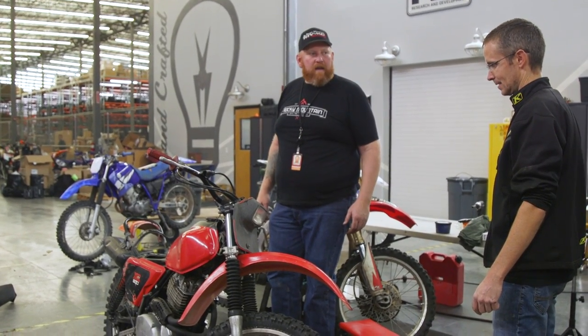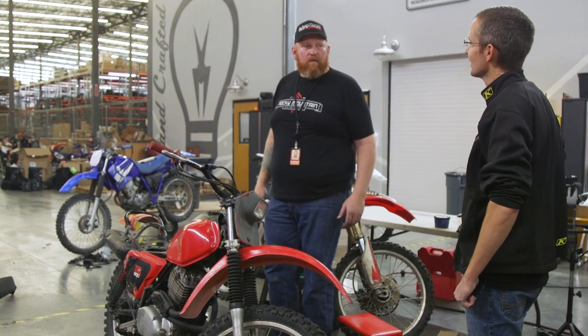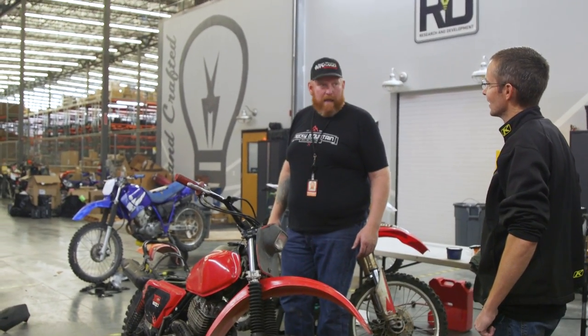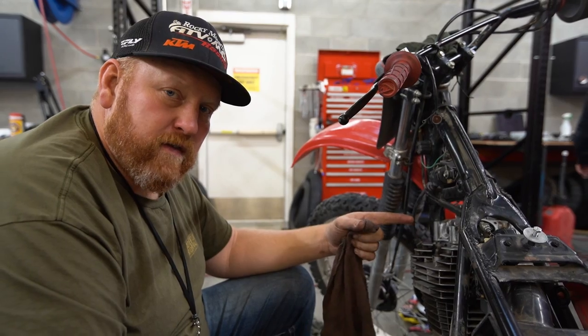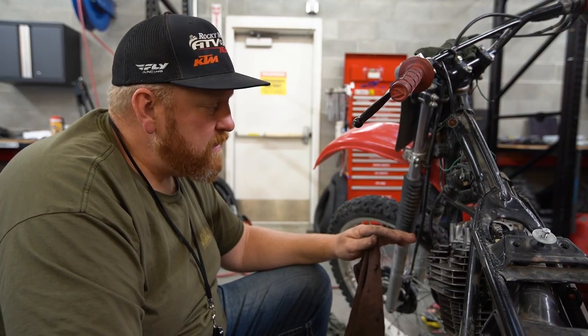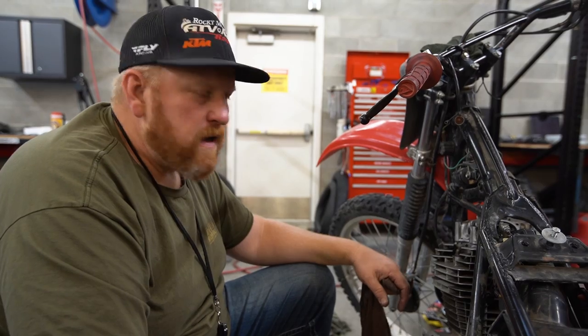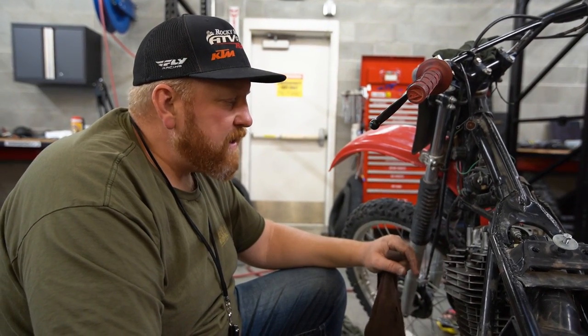I'm sure it's like all Hondas — it's probably cold-blooded; once she's warm she's good. I'm just happy that it idles and comes off idle without any problems. We found stripped bolts, oozing oil, and we tried to pull the valve cover off but there's not enough room without pulling the entire engine. When we cracked the valve cover off, they'd never even had any sealant in there — no bonding agent or anything. I think we can cure the oozing with a little Yamabond 4, glue this thing back together, see what we can do about the stripped bolt, find one a few millimeters longer, button it up, and ride it.